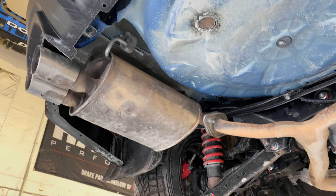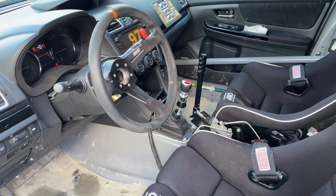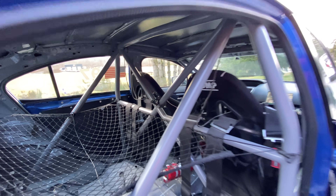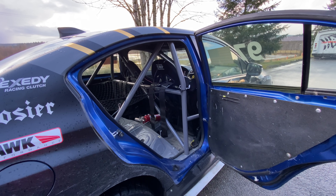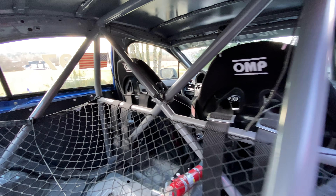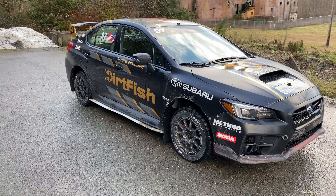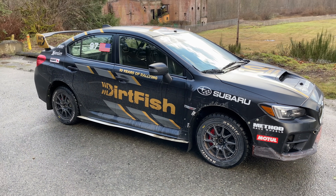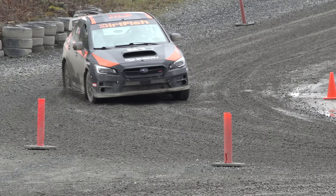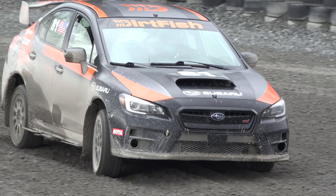Inside the car, it's also a fairly dramatic change. Most of the interior is stripped out, with a roll cage and bucket seats put in. The roll cage is a unique design — not built to meet any specific regulations in this case, but it improves safety with modifications to ensure it's still easy to get in and out of the vehicle. The cable-driven stock handbrake is replaced with a hydraulic handbrake. Once everything is complete, inside and out, they put on the exterior wrap, which is designed, cut, and installed all in-house. As you can see, turning the Subaru STI into a better-performing, safe, and reliable rally machine isn't quite as simple as throwing on some tires.